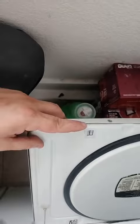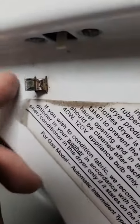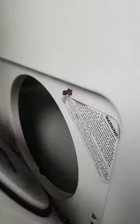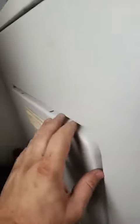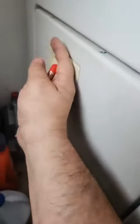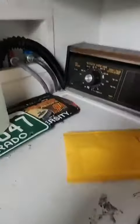When seating the door, it came all the way down and was very flush. Here's the problem: these dryers have a very small switch right here, and the switch is a little short. The way I had it in there before, it would close but not hit the switch — the gap is really really small. What I ended up doing is taking my screwdriver and wiggling it, rising up just the right side corner ever so slightly. When you close it now, that's a solid close.